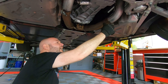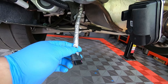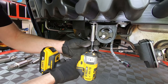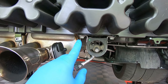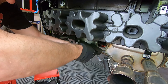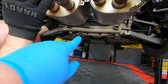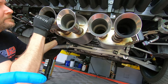So these are the baffle connections — we want to take these off and later we will tape them up out of the way so we can still reuse them if the time ever came. The exhaust hanger uses 13mm bolts — two on each side — and the muffler hangers do get reused, so don't destroy them getting them off. Now we can go ahead and remove the driver's side. You've got to shimmy it enough that the axle pipe disconnects from the X-pipe. This is not going to be a quick process — you've got to work at it separating those pipes because they've been clamped together.